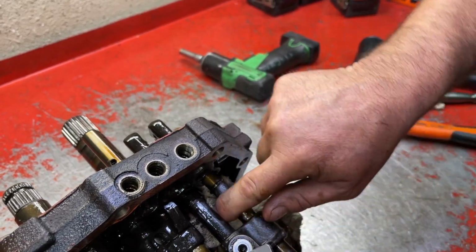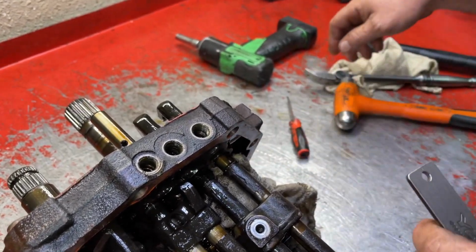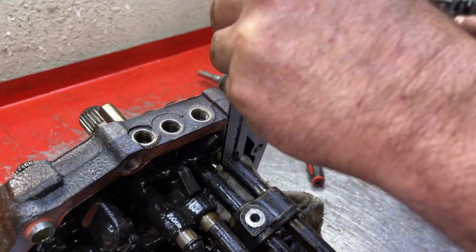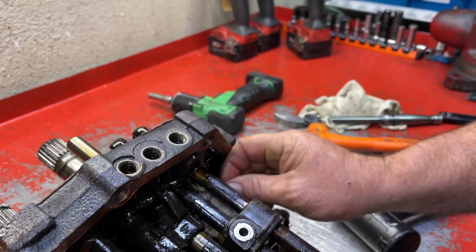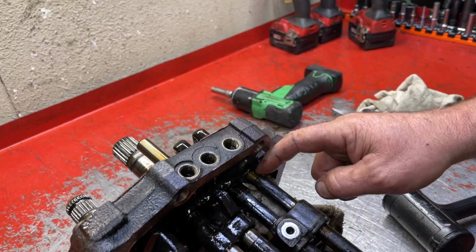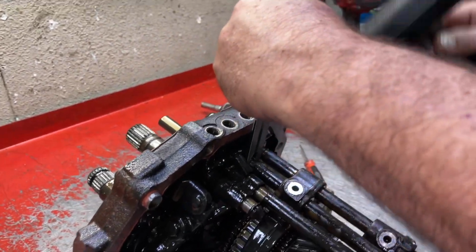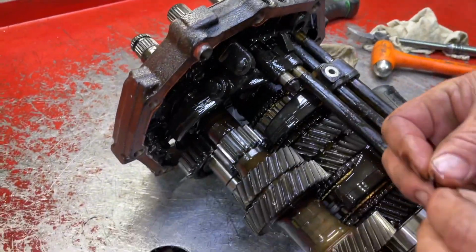We're gonna shove some rags in there so the clips don't go flying. Gonna get them both pointed up. Gonna put your 2 screwdrivers right on the tips of the clip and just pop it off. There's that little tiny clip. Super important. They have to go back on. Those are your stoppers. Those come up and stop the rail against the case. There's one other one.